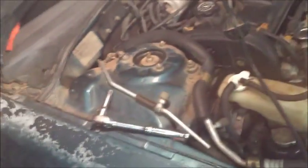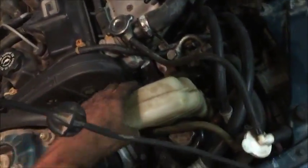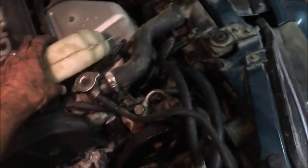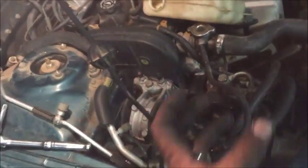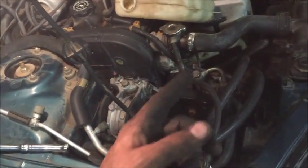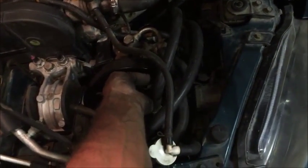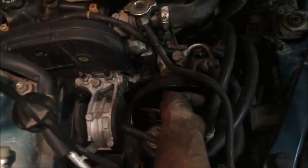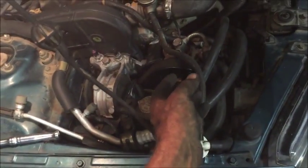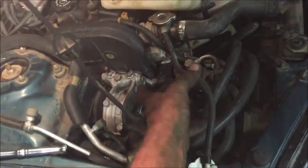So I lost my phone for a little bit but I found it now, so I'm going to recap because I just kept working. You know that the water overflow just slides out. What I did is I finished putting the crank pulley on the bottom — just impact that down as tight as you can get it, or use a wrench with a screwdriver to hold it, just like when we took off the power steering. You're going to rotate this until you see the bolt right in between one of the holes of the pulley, stick a pry bar right through there, and pry it out like you would an alternator, and crank it down until it's tight.